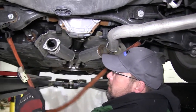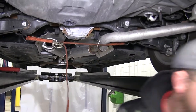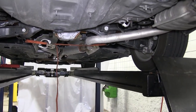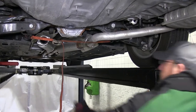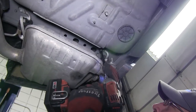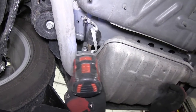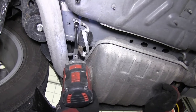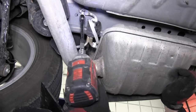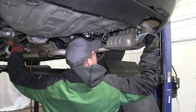Note: I recommend installing a safety strap underneath the exhaust to support the weight on the passenger's side, with the driver's side out and set aside for installation later. We'll also be removing the rubber isolator on the passenger's side. We'll repeat the same process, removing the two bolts securing the exhaust hanger just inside above the muffler. We'll use the safety strap to safely lower the exhaust, gaining access to the frame rail on the passenger's side.